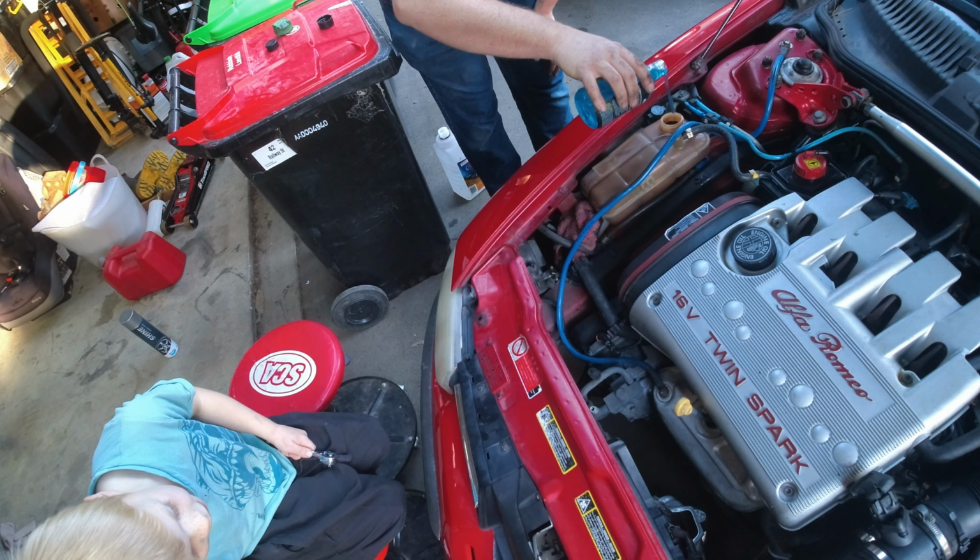Hey, Charlie. Yeah. So it actually cleaned that tank out pretty well. It did a pretty good job, the new Long cleaner stuff. But you saw some of the grime that was coming out of there, lots of scale and rust. Apparently this car did have a new radiator at some point a few years ago, probably 100 years ago. So yeah, I'm pretty pleased how that's cleaned up. But it's not going to be perfect. Seemed to have slightly more heat output from the heater, but again, it's never going to be perfect, and I couldn't actually find the heater hoses to back flush your heater core, and that seemed like too much effort.